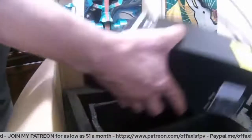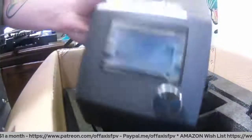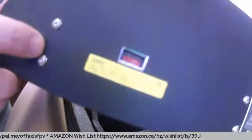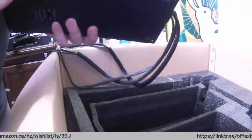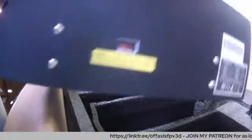This camera is not going to be the best angle all the time, but so yeah, here's the power supply with the screen. Very basic, very big unit. Going to make sure the switch is switched to the right setting. For me, it's actually going to be the other setting, not 230. So you just flip that over to 115 for Canada, maybe also US.